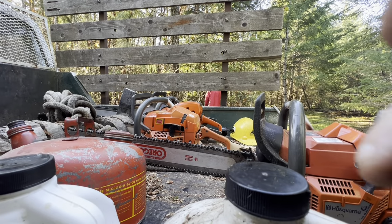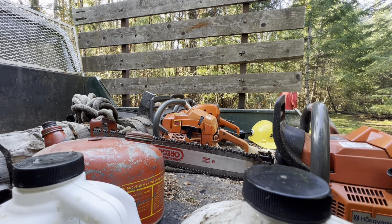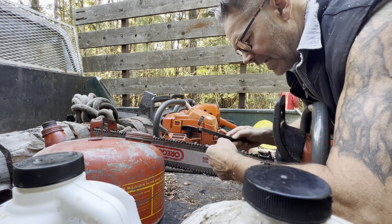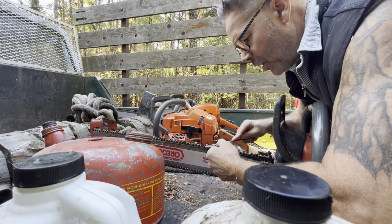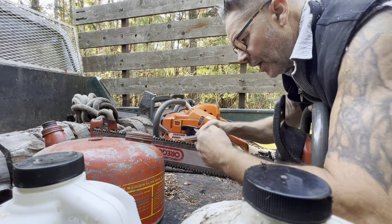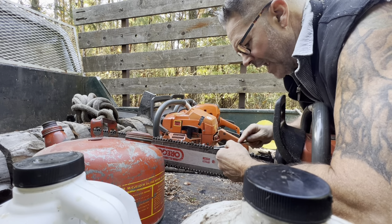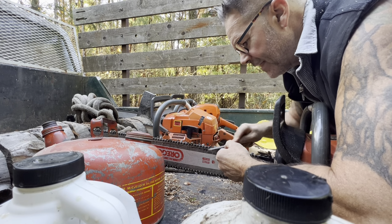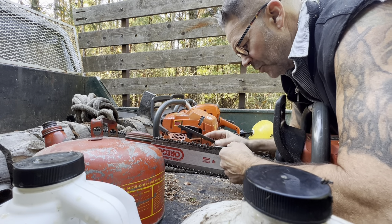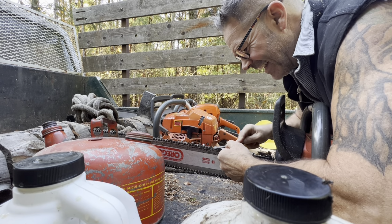I might even be able to get you guys rolling here just like that. Oh, I can't believe it. I did it. Okay. Raker gauges, friends. This is the gauge. Last time I had Pavarotti out, like I told you, it wasn't cutting like I wanted it, and now I see why. I'm on the hard setting, friends, which means not a real hungry setting, and they're still peaking up above the high setting, or the hardwood, pardon me. Oh yeah, I can't even believe this. That is actually hilarious to me. I'm always running different. This makes a lot of sense now. Look at that. Oh, that's funny.